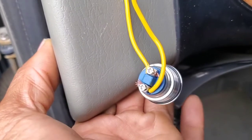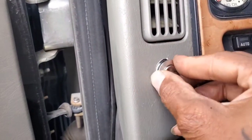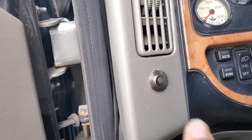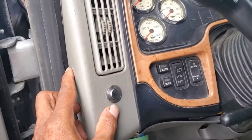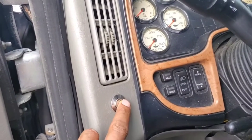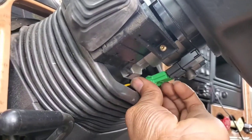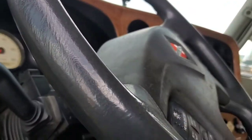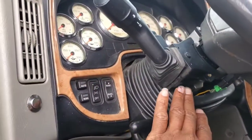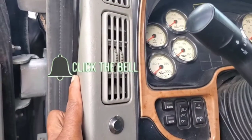The back screw for the interrupt switch is on the inside, so I'm going to push this in. That's how it looks — there's some glue on here. Alright, the switch is in place and the horn is working beautifully. I'm going to plug the clock spring harness back in because some of the functions still work on the steering wheel. Now I'm going to put the black cover back on and we're all set. If you haven't already, please subscribe to the channel and I'll see you in the next video.